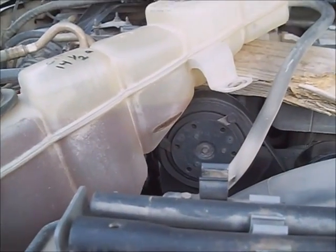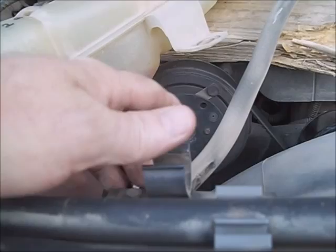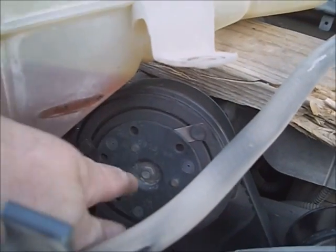You've got to take the tire tool off, put the butterfly off to get the tire tool out of the way, take this bolt, take the overflow tank up — there's two bolts down here — to get access to the clutch pulley. I just turned the overflow tank at an angle over the top of the compressor clutch plate.